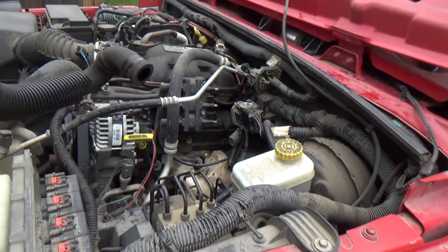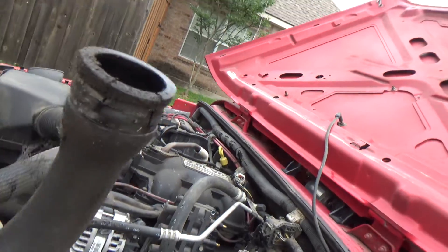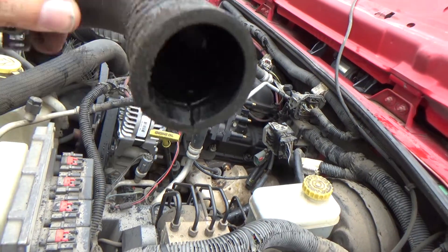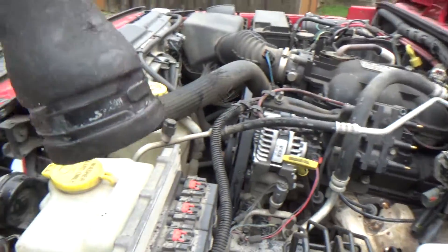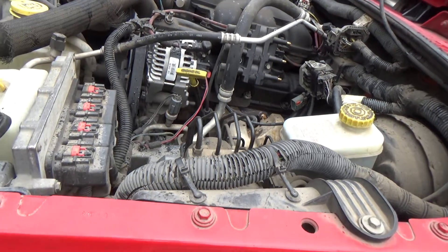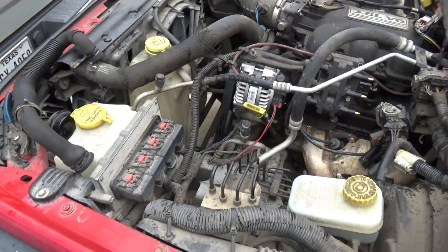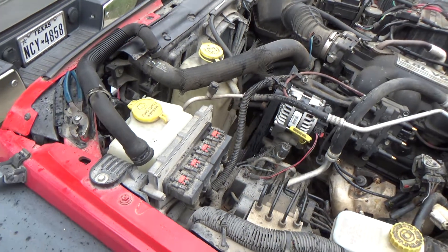Just in case you're curious — look at that. It's cracked in two places, and I would not have found that for a very long time. That was hidden back behind everything, so you couldn't see it. By the way, that's your PCV valve hose. Just doing a quick test of a smoke machine and we actually found a vacuum leak. If you need a smoke machine, that one seems to do the job. Just be aware of the 15 PSI pressure.